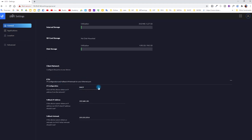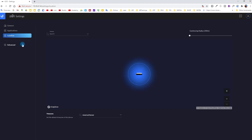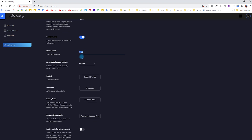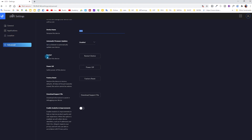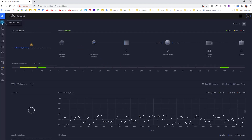Here is where we set the DHCP clients. Under Applications, we have UniFi Network and UniFi Protect running — you can shut them down or restart the services. I don't have UniFi Access or UniFi Talk, just these two. Under Location, it will try to get the device's location but I don't want to do that now. Under Advanced, you can activate remote access — which I'm enabling in my case. The device is named UCK. You can configure automatic updates, restart, power off, or factory reset the device.